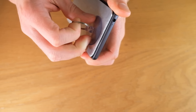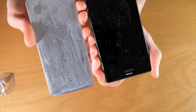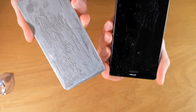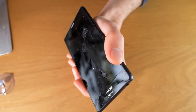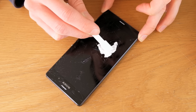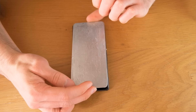That does not look good. Okay, so that's not worked at all — the glue has just not adhered to all of the glass and it's only pulled away a few shards. I think one of the reasons the glue didn't stick is because the instructions say surfaces have to be lightly sanded, which I didn't do. So I'm going to lightly sand the glass and fill the gaps with some cork so that the second attempt epoxy won't glue to the screen itself, and then try again.